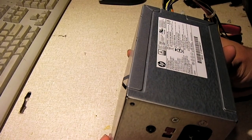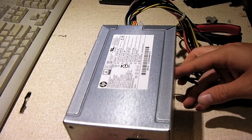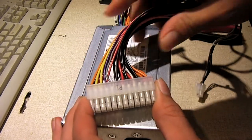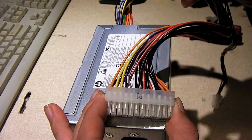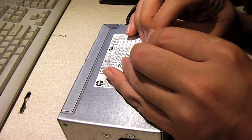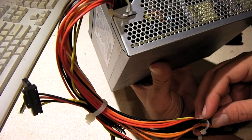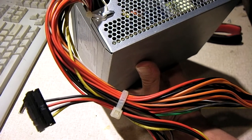This thing was specced to provide the needed power for the stock system and only that. Same goes for connectivity. You could actually plug up a second hard drive if you wanted to with this thing, but that's about it. Because you only get a standard 24-pin power supply connector, a 4-pin CPU power connector, two standard SATA power connectors, as well as a 5-volt SATA power connector for the little laptop ODD drive that was in this computer. That's all you get for power connectors, and all the wiring is 20 gauge. Generally you want the wiring to be 18 gauge at least, but I've seen quite a few OEM supplies with the thinner wire.